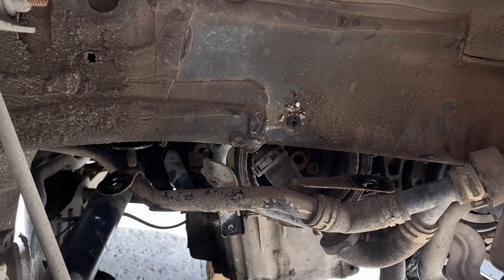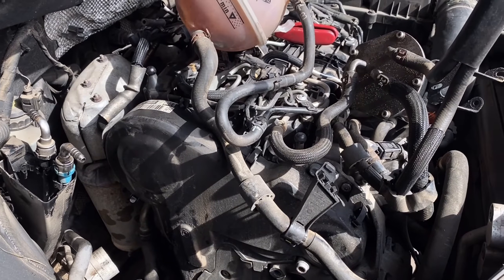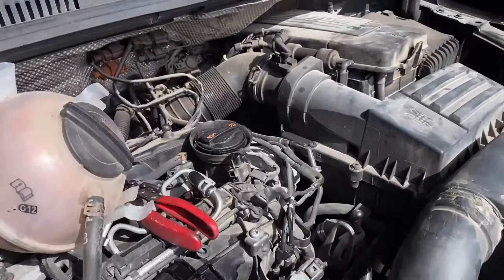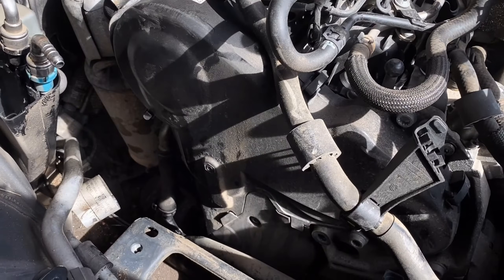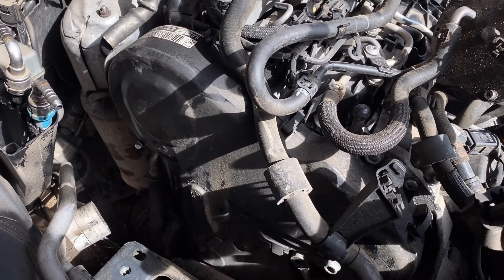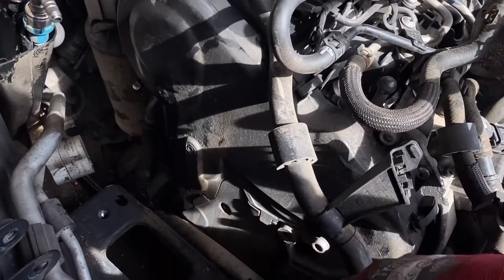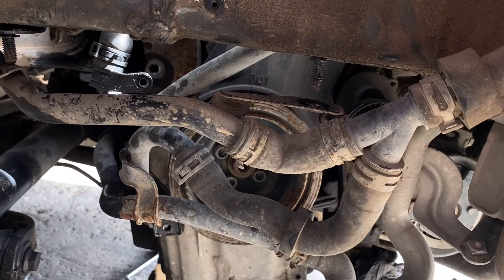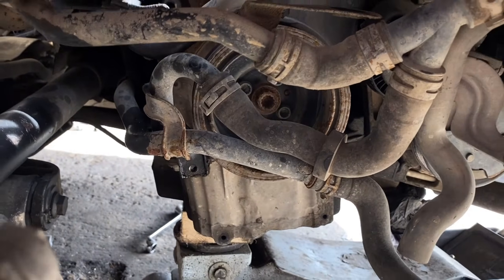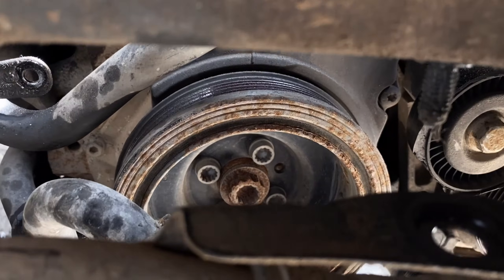Get the top two 16mm bolts off, then lower the engine down and go in the wheel arch to get the bottom 16mm bolt that holds the engine mount on, to get that engine bracket out. Then jack the engine back up. Be careful when lowering and raising the engine because you have DPF cables there you don't want to snap. On the top engine cover there are a couple of quick clips — pull them off. Top timing belt cover is off. I've lowered the engine down again and I've undone the brackets on the water pipes — two 13mm and a 10mm — giving a little bit of leeway.